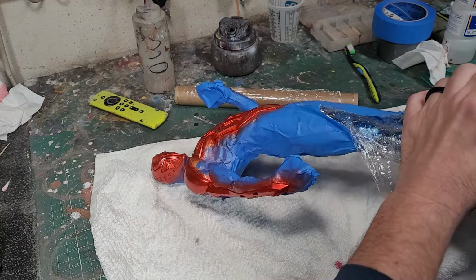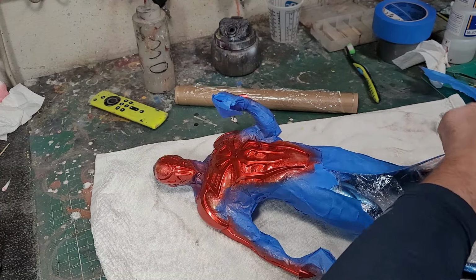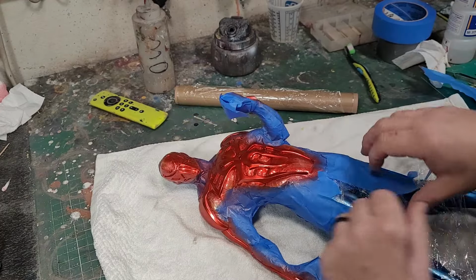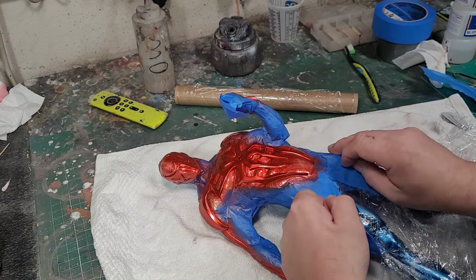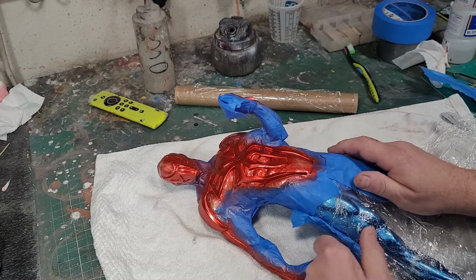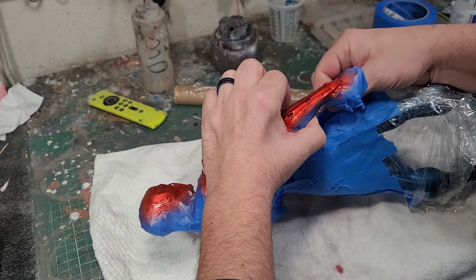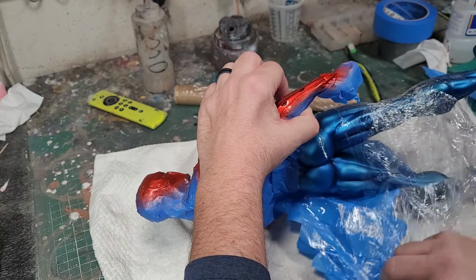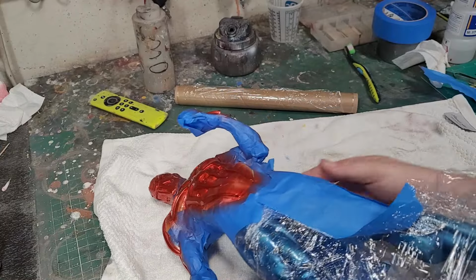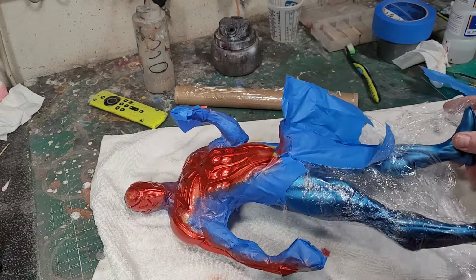I'm not gonna do this all on camera, because it's gonna take me a while, because I've got all those little tiny pieces of tape. And sometimes I actually have to go around and cut around the edge of the tape just to be safe as far as the paint lifting. And as long as you're careful, until this clear coat is 100% cured, and it continues to cure for about 30 days. So an automotive clear coat continues to harden for about a month.